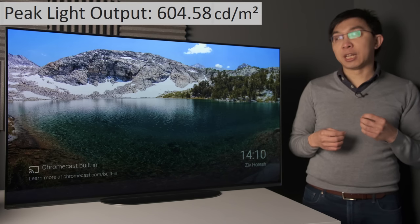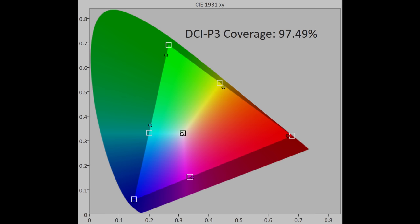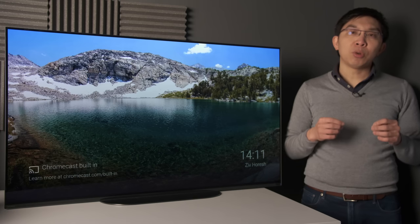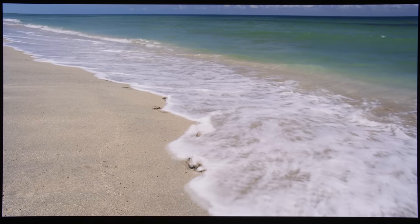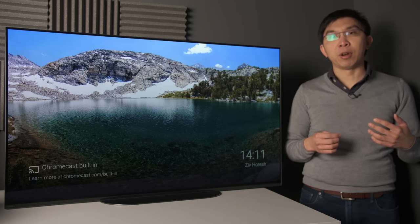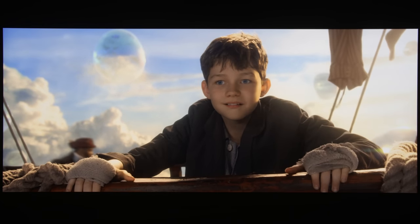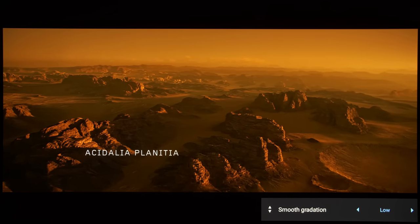For HDR, peak brightness measured 600 nits on a 10% window after calibration to D65 white point and 130 nits full field. DCI-P3 colour gamut coverage came in at 97% UV, while BT.2020 coverage was 74%, with the spectral power distribution showing a waveform typical of white OLED with colour filter. Thanks to OLED's pixel-level light control, HDR movies looked supremely refined with no blooming or haloing artefacts, although bright scenes would appear less impactful than high-nit LED LCDs due to ABL restrictions. Consistent with Sony's philosophy to prioritise maintaining average picture level or APL over preserving all specular highlight detail, the Bravia A9 clipped some of the brightest detail in 4000 nits content, for example around the sun and clouds in Pan. Sony's native gradation was already the best among all TV brands across a variety of HDR movies, and engaging smooth gradation drove home the advantage even more.